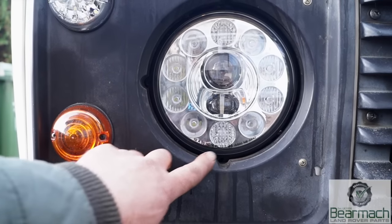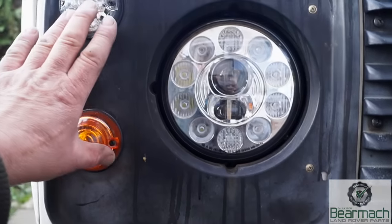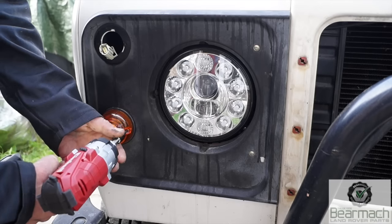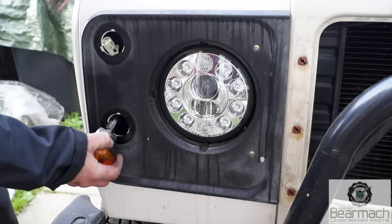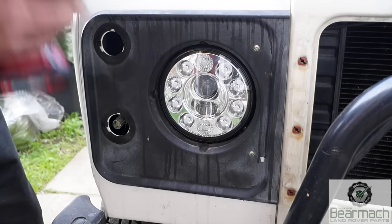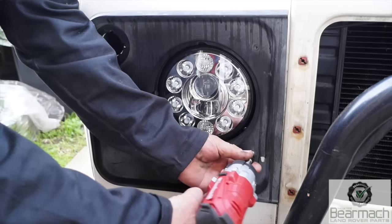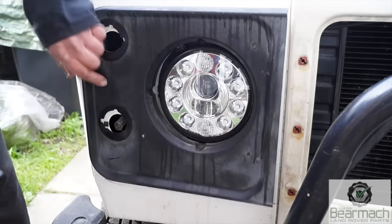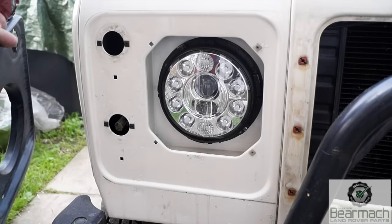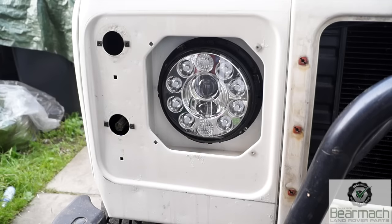The headlamps, as mentioned in the earlier video, have two adjuster screws. To remove the panel you undo two screws and then remove your indicator and side marker lamp - easy job done with a power screwdriver. Now what I've noticed is that some of the looms are a bit short at the front here, which is a trouble when fitting the fittings back in. You move two screws here which lets you access the screws for the lamp unit. Be aware that when you remove the screws they might drop down and disappear - it's happened a couple of times changing the lamps on this vehicle.